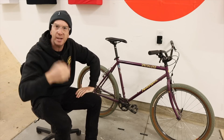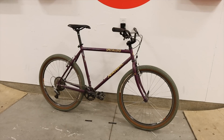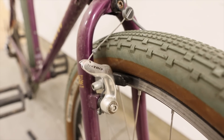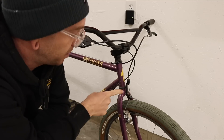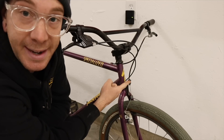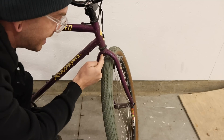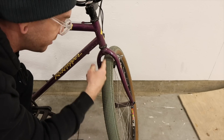So considering it's still drizzling out right now, I thought it'd be fun to go test the cantilever brake setup in somewhat damp conditions to see if the stopping power is ample. Little bit of a spoiler here — they do. Let's talk about the setup. This is my 1993 Specialized Rock Hopper, and I've got a set of silver Tektro Oryx cantilever brakes front and rear. The front brake performance is aided immensely by the crown-mounted cable hanger, which are really hard to find now. To make the crown-mounted hanger work on this bike, I also had to drill out the rear hole on the fork a little bit to fit the bolt.